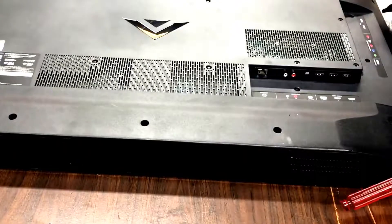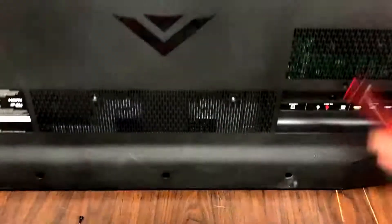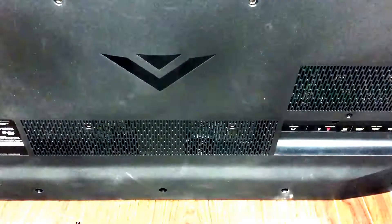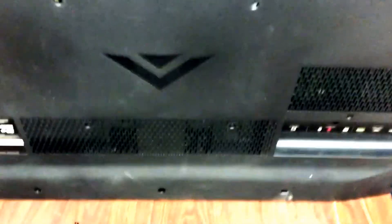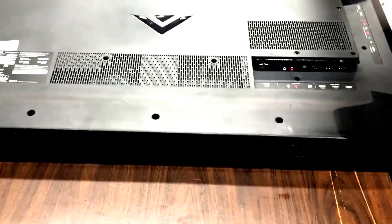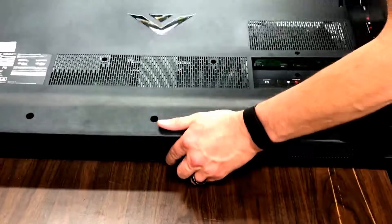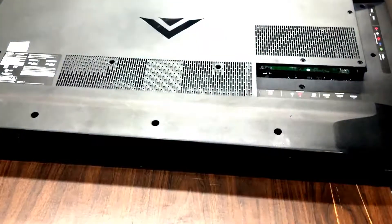You're going to have a couple of screws on the bottom, two per speaker. I don't think that's going to be necessary for disassembly, but it is going to be necessary if you want to replace those speakers. Stand it up and separate everything — just a little pry along the top if you've got some fingernails, otherwise I recommend a plastic pry tool. From the inside, it doesn't look like the speakers are holding onto anything.